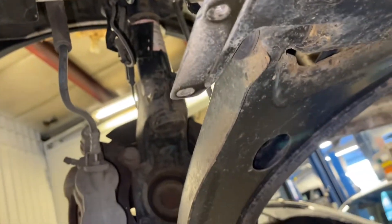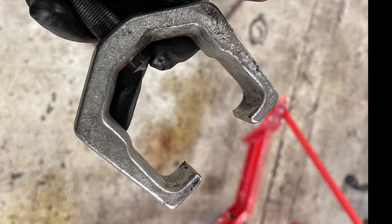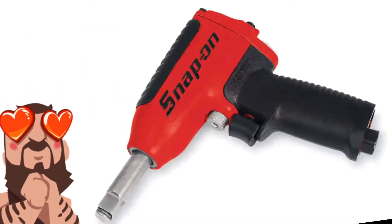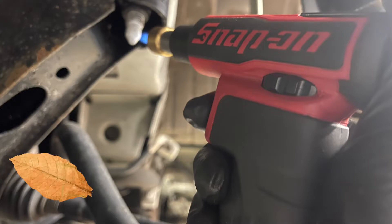There it is — you're not going to be able to take it out without dropping that subframe. I started by removing the lower ball joint, lower control arm connection right there using a Pittman arm puller, which was the best way to go to get those loose. They were very stubborn. I had to heat up these nuts — there are two nuts that hold up the front of the control arm and those were very stubborn as well. I couldn't get them off with the impact, even with a massive impact gun. It took the right amount of heat, using a heat gun I normally use to light cigars.